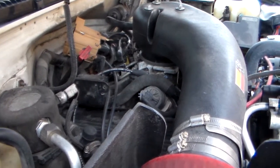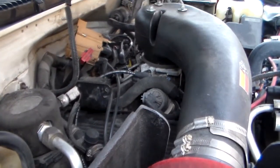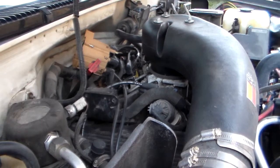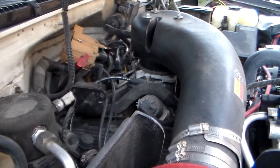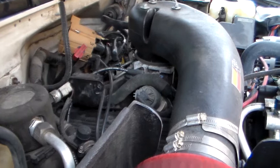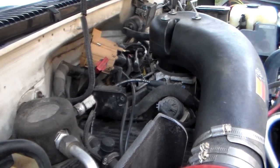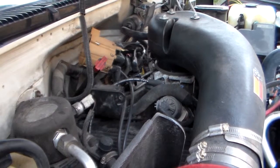I'm not positive. I've got the tow truck coming at some point because I don't have any way of replacing it right here. So I'm just going to have it towed back to the house and go get a distributor cap and rotor. I'm not going to do anything else to it because all the wires still look good and everything looks fine. That's the only thing I can find that actually looks like it could be the cause. So until I get those two replaced, I'll try it again and see if that fixes it before I start messing with anything else.